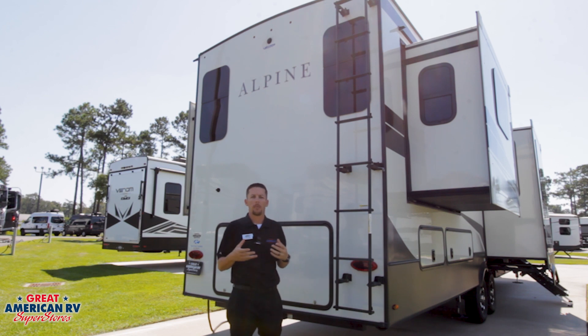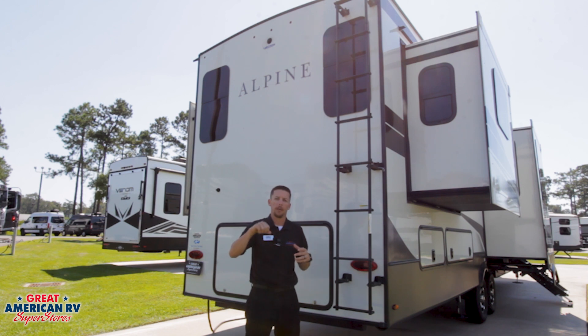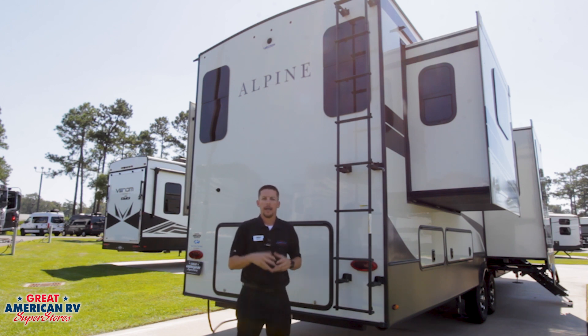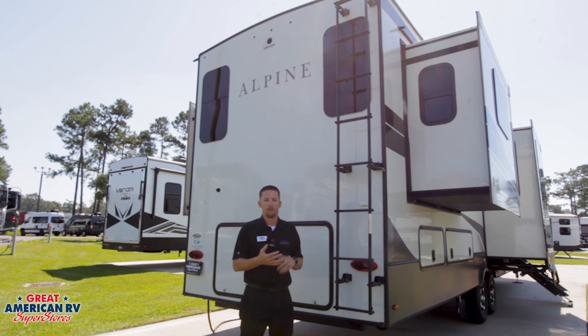These lights are operated by your vehicle. This would be on the seven-way plug that comes off of your kingpin and connects to your truck. That is the only source of power that these lights get — there are no fuses or anything else inside the unit.